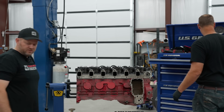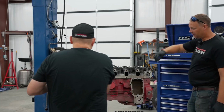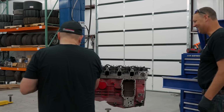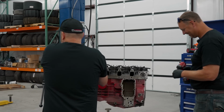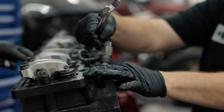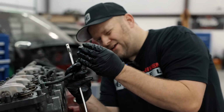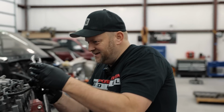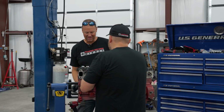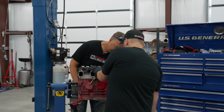Oh, I'm gonna get these injectors out. Those are still good, I think. Those John Deeres, man. When you're working on a John Deere, you need a big wrench. Gosh. It's a little too big for the job. Look at that. Big ol' holes. You can see daylight through the nozzle. You know it's big. They were big. I think those are 5x38s. Yeah, they're monsters. They're either 38s or 35s. I don't remember which set we were in on the dyno.